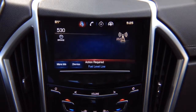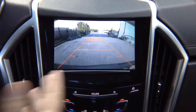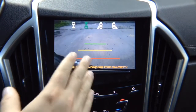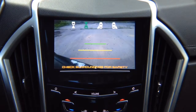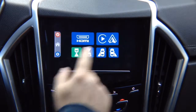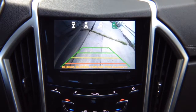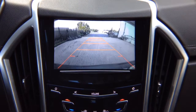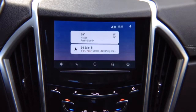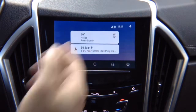If you did not install a right side camera, nothing will switch. In reverse, you got the factory rear view camera if you have one — if your car is not equipped with one, you can add one. In drive you got front view camera — front view camera shuts off automatically after 10 miles per hour. If you didn't install front view camera, when you put it in drive the vehicle will switch over into the factory menu. Now, if you're in interface mode doing Apple CarPlay or Android Auto, the left turn signal brings up left camera automatically, right turn signal brings up right camera automatically, reverse shows factory or aftermarket camera, and drive shows front camera. If you didn't add any of those cameras, it will not switch.